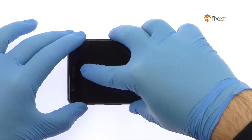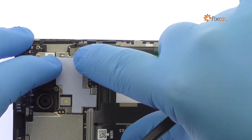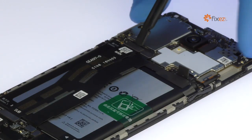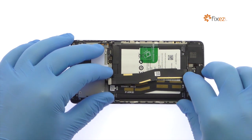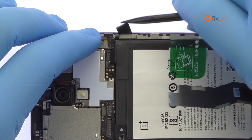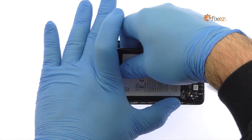There is no pesky adhesive making this procedure a snap. Detach the OnePlus 3T battery from the motherboard. Remove the Phillips screw and metal bracket. Spudge up the interconnect cable and the USB-C port cable from the motherboard. Remove the interconnect cable. Use the exposed clear plastic pull tab to peel the 3400 mAh battery off the adhesive securing it to the OnePlus 3T.